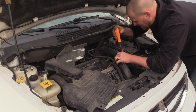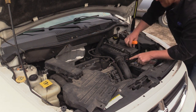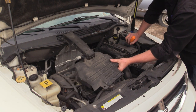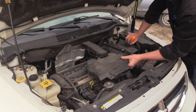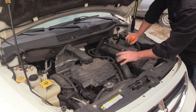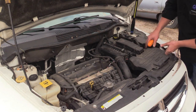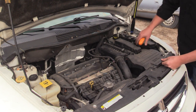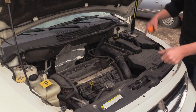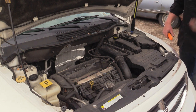Good timing, Pete. We're just talking about how to handle something like this. Intermittent faults, had intake air temp sensor wasn't plugged in all the way. So someone was in here and put a new air filter in this, and this was actually sitting to the side. I don't know if somebody jump started the battery, but the intake air temp sensor wasn't plugged in, but I have some history codes for the transmission output speed sensor. But everything looks good. I cleared those faults. Nothing's come back. There's clips that are missing right here. I don't know where they are. But I cleared the faults, give this back to the customer and let them drive it.